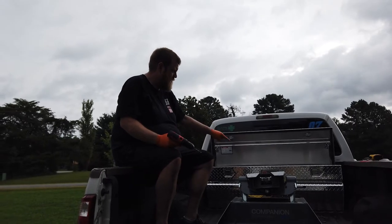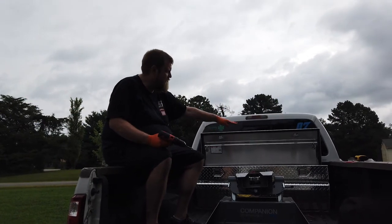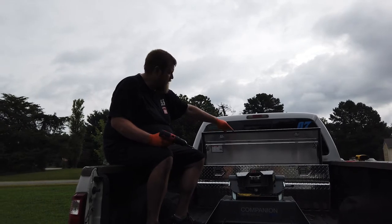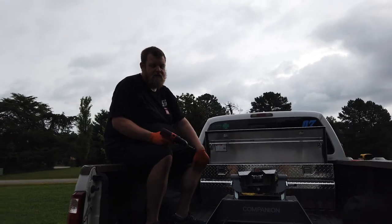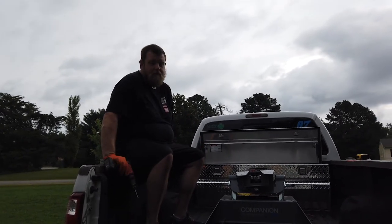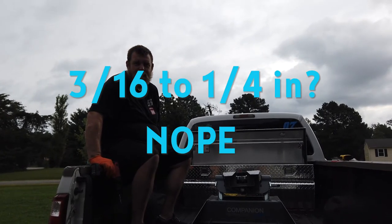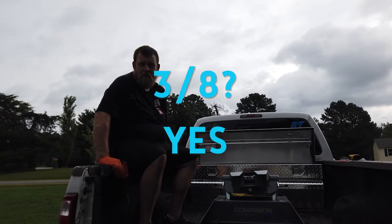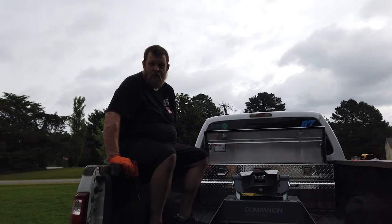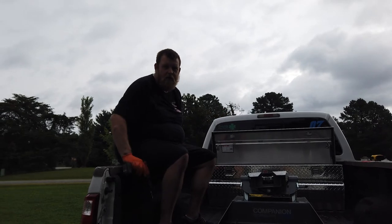Today we centered the toolbox and I measured the outside of the box to the ridges, because on these boxes you want to make sure wherever you put your bolts they go in the ridge that comes up — that way it's a nice flat surface for the bolt. The directions call for 3/16 to 1/4 inch bolts, but I don't think that's nearly enough, so we went up to 3/8 bolts with fender washers to make sure you get a nice even spread of the load.